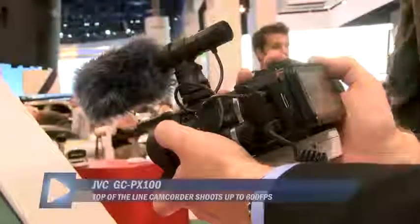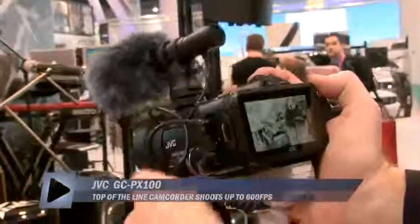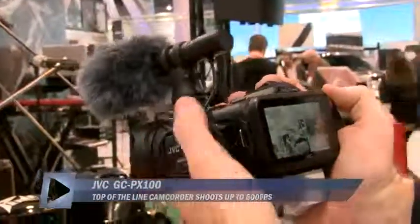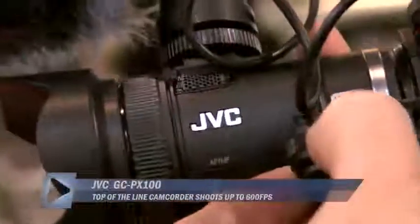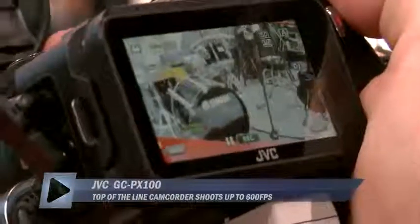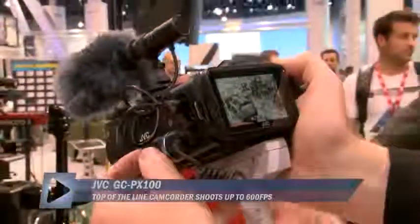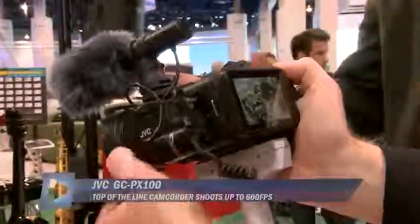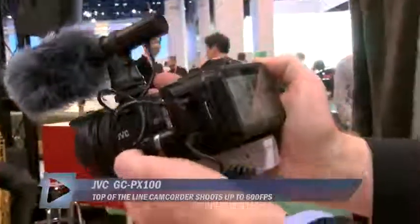It's very selectable. It has a wide range of unique WiFi functions and apps. It's also a multimode recording camera — it can record AVCHD, .mov, .mp4, and iFrame. It can do up to 40 megabits per second. This is 1080 60p, so it's progressive — effectively double the resolution of broadcast TV, more in line with Blu-ray.